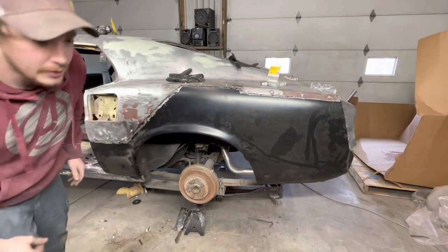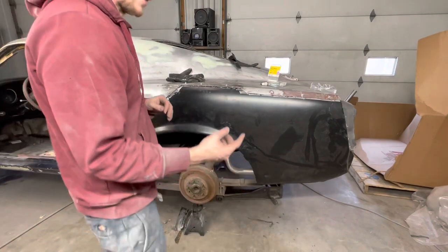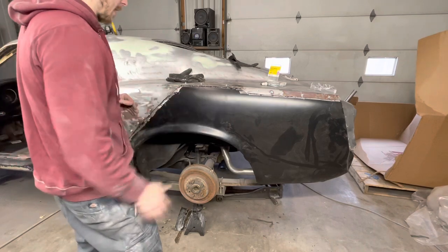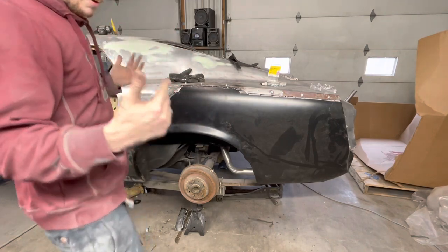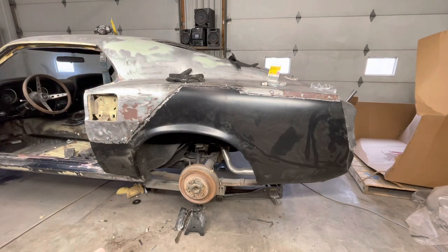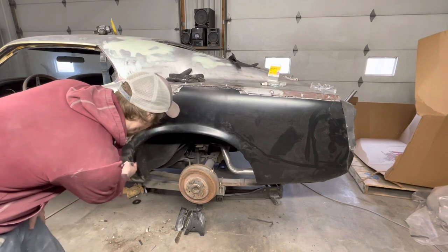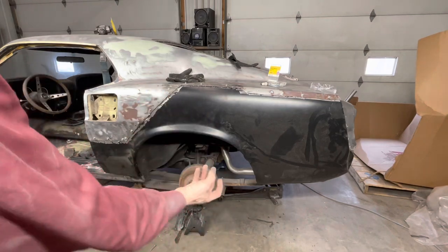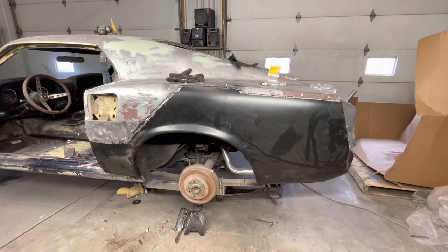What I like to do now is grab a glove, put a little panel bond on my finger, and run it along that seam. After all this cures you just grind back the excess. I'm also going to run all my other self-tappers in here to suck that back in underneath, and then Monday I'll do the welding underneath and all that. But there you have it - quarter panel is technically in. Honestly so far not too shabby. Check out the other videos and hopefully this will be done by May.